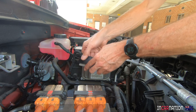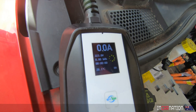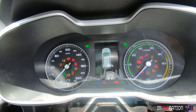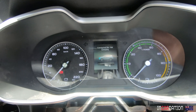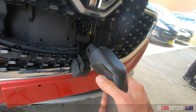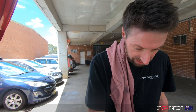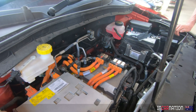It's showing voltage in but not charging. We've just disconnected the ECU - it's connected but not charging. We might need the ECU. It's not locking on and there's no charge. I'd say it probably controls monitoring of the batteries, and it probably does the interlock for that actual charge connector. It also monitors the temperature of the charger because it needs cooling.